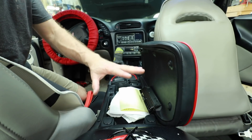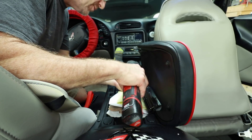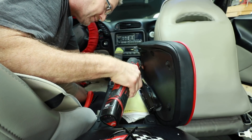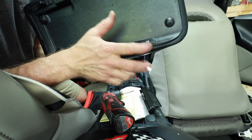To get this radio out, we start back here. Begin by removing the arm pad — it has four Phillips screws in it that are very fragile. You can use a drill to get them out, just go slow, but definitely don't use a drill to put them back in. What happens is these little silver posts will just twist right off and break.